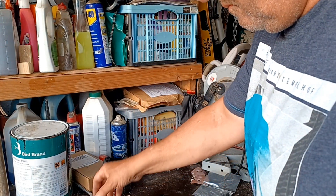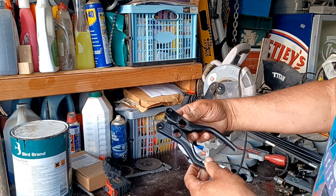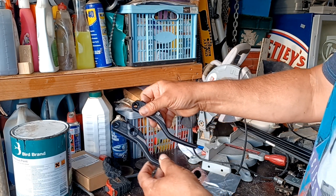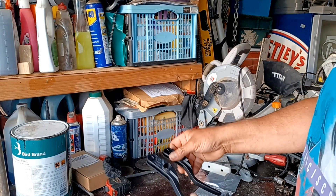Try and get comfortable and hold the whole clutch lever in position as you're pushing the bush out. Check the new parts — they look the same. I was thinking at the time that this lever was the same for the clutch as the brake. I just ran out to the garage and had a check, and it is — just put together the other way around.